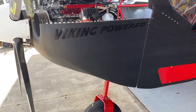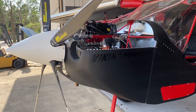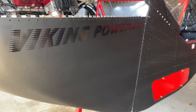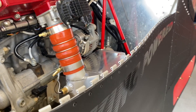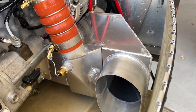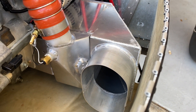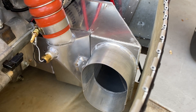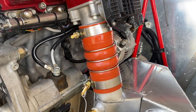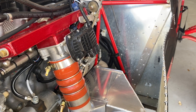That's all there is to the cowling installation — it's very simple. You do have to formulate an inlet duct for the intercooler, and we'll talk about the intercooler installation next. Exactly how big of an intercooler do you need? In racing circuits that allow turbochargers, that question is always answered by 'as much as you have room for,' and that's true when you're running a lot of boost. The cooler you can make the air coming through the turbocharger and into the engine, the more horsepower you're going to make, and you reduce the chance of detonation.